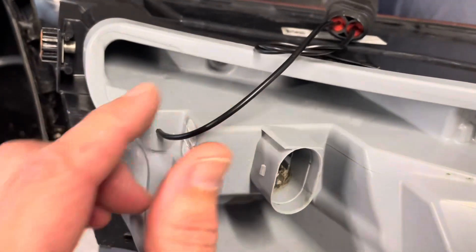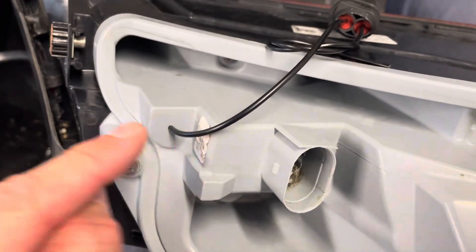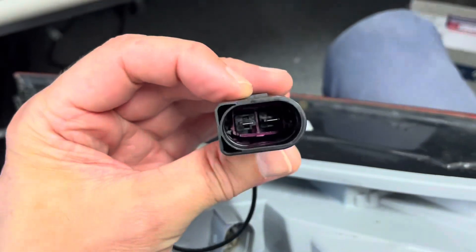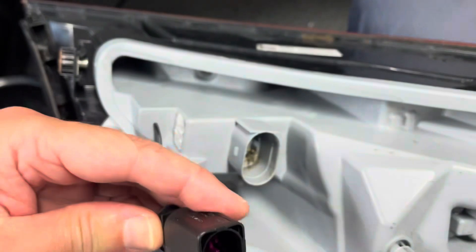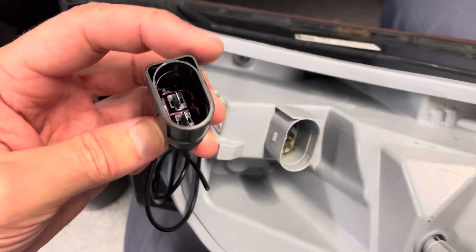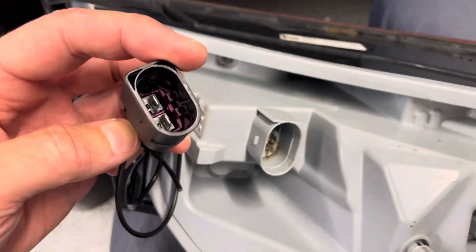What I've done is run a separate wire. I've made a tight hole here so this sort of seals in the hole. I've soldered this to the earth bus bar inside and then I've used a much higher current connector here. It's the same style as the other one, same make, but this is a 4.8mm contact which has got a much higher current rating.